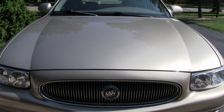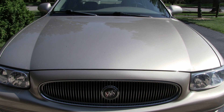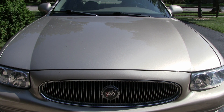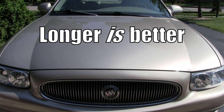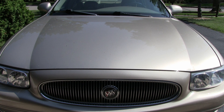It's really only three simple steps: drain the coolant out of the radiator, seal it up, fill it up with distilled water. Drive it around for a little bit. I don't think 20 minutes or a drive is really going to do it — I think days or even a week to drive it around before you drain it again. Rinse, lather, repeat the process until you get the water clear.